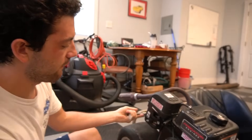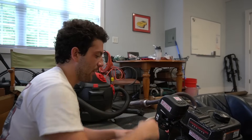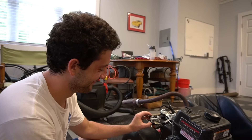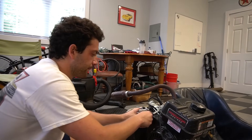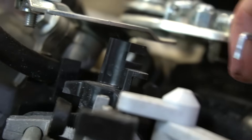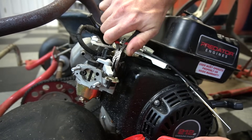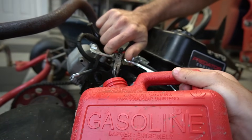To get the factory air filter box off, you're looking at two 10-millimeter nuts. Once you unhook your linkage, grab some pliers and take that clamp off so you can drain the fuel. Pinch it off so when you pull it off, there will be very little spillage. And there's the carb.